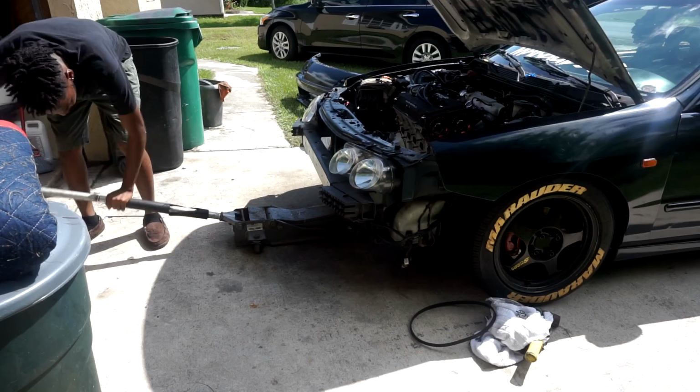So let's start off by draining the oil, then drain the coolant. I gotta drain the coolant from the block, which is gonna get all over the new painted block. But it's gonna get dirty regardless anyway. So let me just drain the coolant, drain the oil, bleed the clutch, and that's it. We can start the car, son.